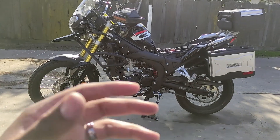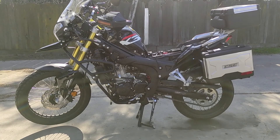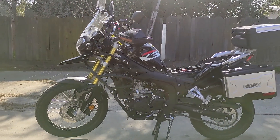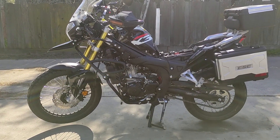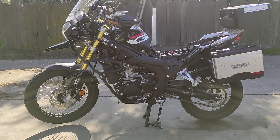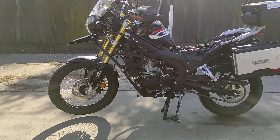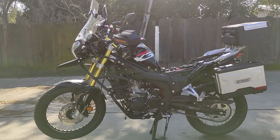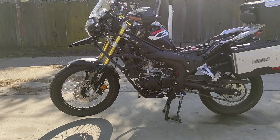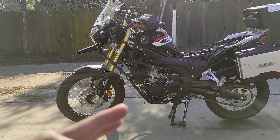And with that being broken, fuel was just leaking everywhere. Talking with TK from CSC, he said that I could probably just find a replacement brass T-fitting, which I did — I found one at AutoZone. If you're looking to upgrade or replace that T-fitting, because it's plastic, upgrade it to a brass one — you're going to need one that is a 5/16th inch diameter.